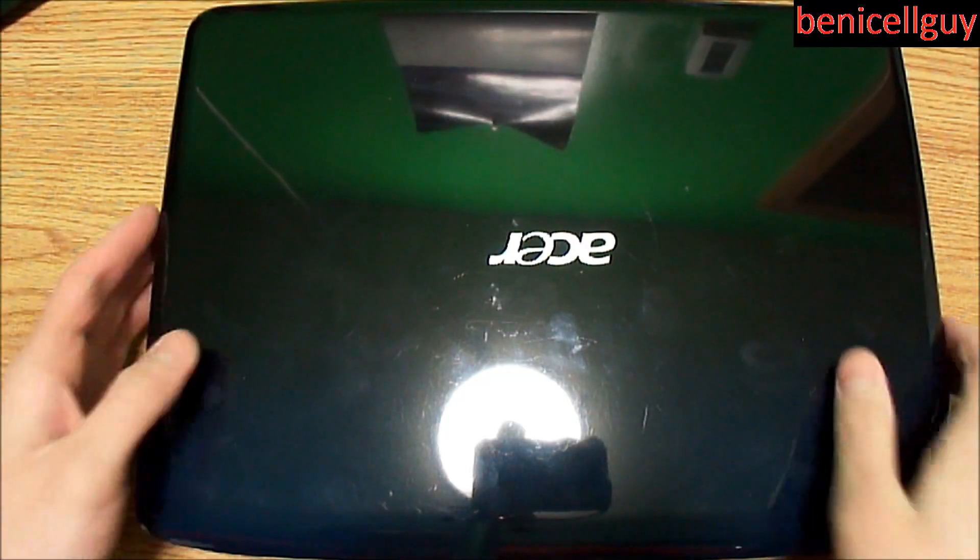So I'm going to show you how to replace this hard drive with a different one. The hard drive I'm going to be using is a 320 gigabyte Western Digital. What you're going to need is your new hard drive and a small Phillips screwdriver — that's it, that's all you need for this installation process.